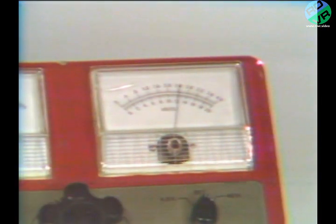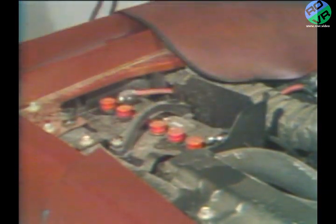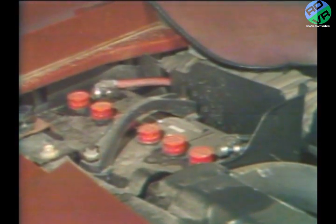If after this period of time, battery terminal voltage does not fall below 9.6 volts, the battery can be considered in satisfactory condition and fit for further service. A battery that cannot pass a high-rate discharge test when it is in a full state of charge is not up to snuff and should be replaced. We will admit, however, that there are probably a lot of batteries currently in daily service that could not pass a high-rate discharge test. These batteries are doomed to failure.